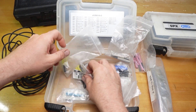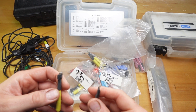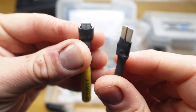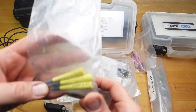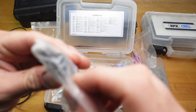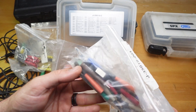So these are all kind of separated out — some of these say SPX OTC. What this kit basically is, is a lot of different electrical connectors, male and female. Say you need to test a relay — you figure out which one you need and then it just plugs in. The nice thing about these banana plug style connectors is you can plug into the back and plug the other end into your meter so you can watch what's going on in the circuit. There's little round ones, male and female, little square ones, flat spade-style connectors, weather pack connectors, and after-treatment connectors — just a whole kit full of different ones.